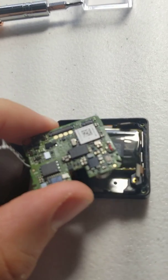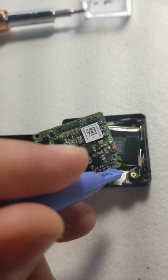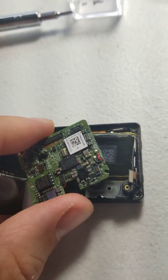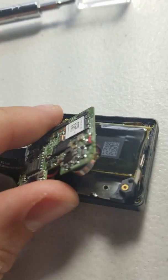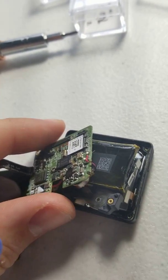It's round and it's partially hidden, but you have to use a spudger and pry it up and release it, and that will release the motherboard. I found not a lot of videos even really described it that well, but it's pretty stuck on there, but then the motherboard will be loosened.